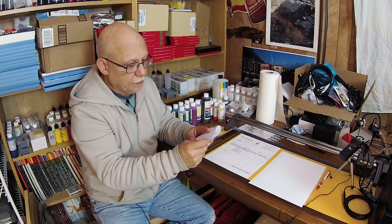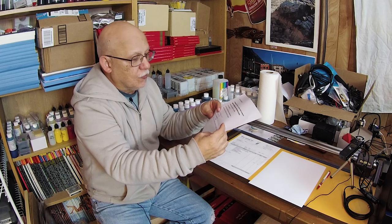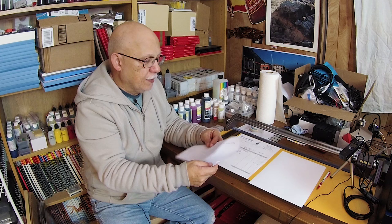What to do: take a sheet of paper, fold it in half. You wet the bottom half with isopropyl alcohol, stick it in the top feeder, and press the feed button. The paper advances through and picks up dust and junk accumulating on the rollers, and the dry side dries the rollers. Just repeat that five, six, or seven times and then test the printer once more.